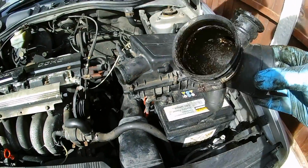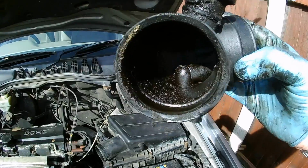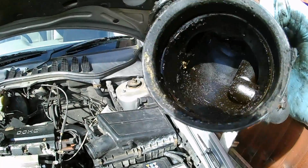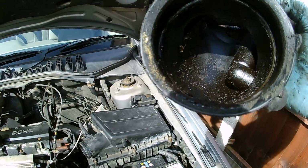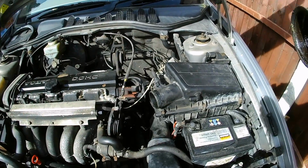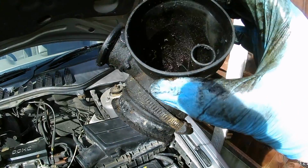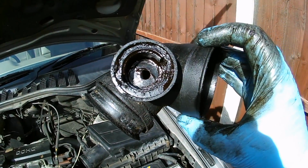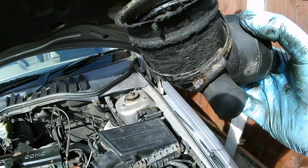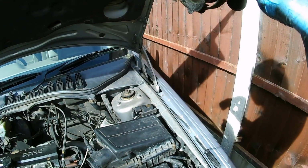And then I've got the inlet to the, this is actually the air inlet, but you look at that, and that's quite clear that there's been a lot of muck build-up, and that's actually going straight into the air intake into the manifold, and it's just absolutely filthy. So I think my task for today is to find a way to actually clean all of these deposits off. I've scraped a few of the chunkier bits of carbon and other such rubbish.